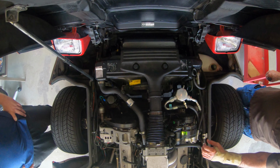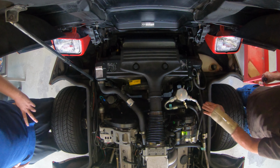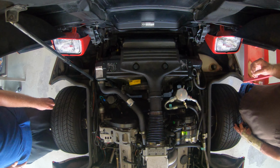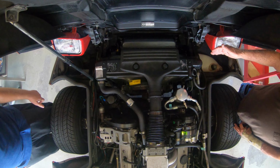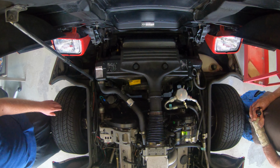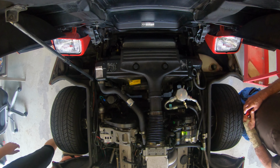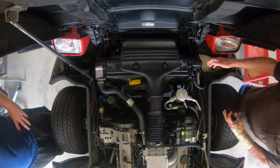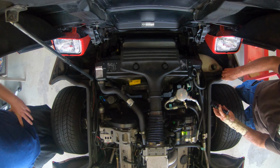We put in a new compressor, and we put in a new accumulator, and our last step is, as a result of unfortunate rock, we're going to put in a new condenser. And I'll post a picture of that in the video, because it's a pretty good sized chunk. Yeah, we'll show you that later. And a couple of things have to be done before you can get to all of this: there are several things that need to be disconnected.